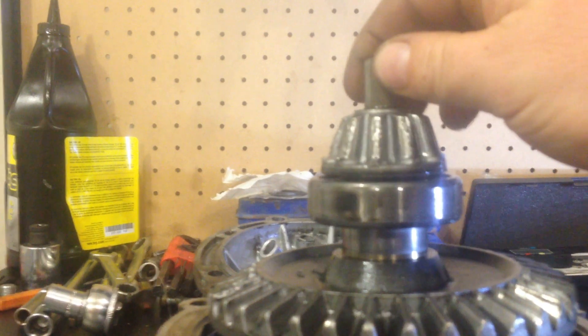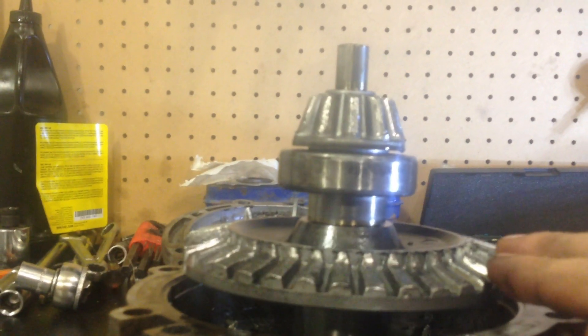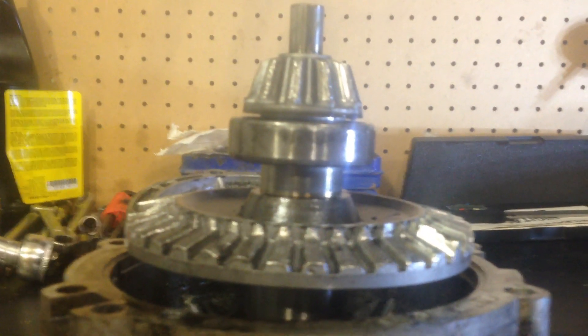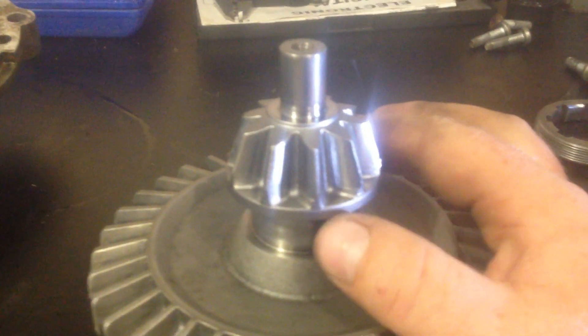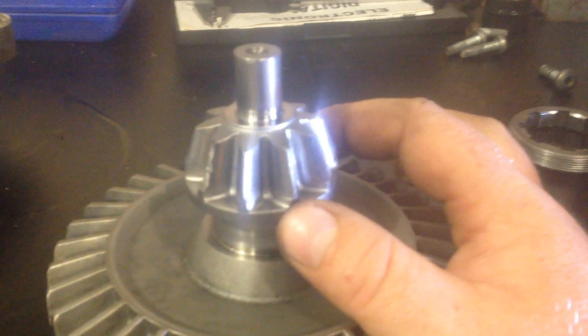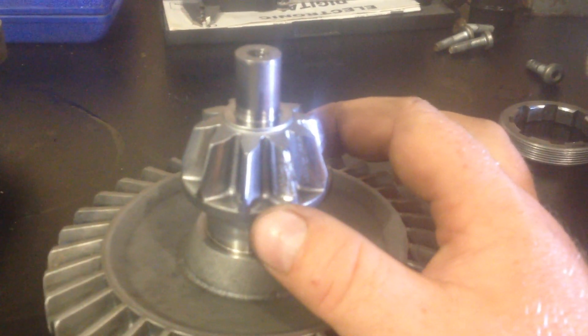He's completely toast. Most of those gears broke off first, and then as it got loose inside the diff, it started smashing out the ring gear teeth. It's at this point that most of these diffs will blow in half. This customer of mine got pretty damn lucky — I think I can reuse this case for his Commander. You can say this is improper heat treatment, but I'll tell you what: when it's even worn this bad, there's still heat treatment left on those gears. We're not down to the cast metal yet, we're still in the heat treated stuff. It's not until they start pitting like that that they get out of the heat treated material.